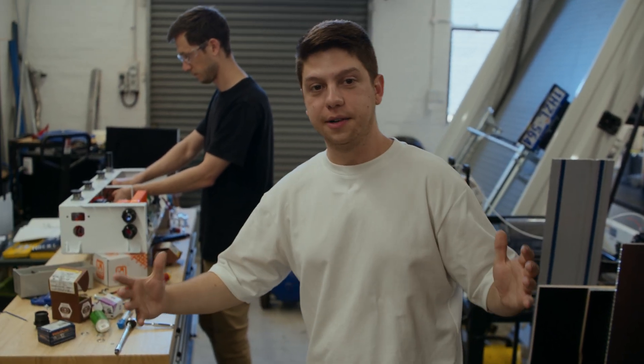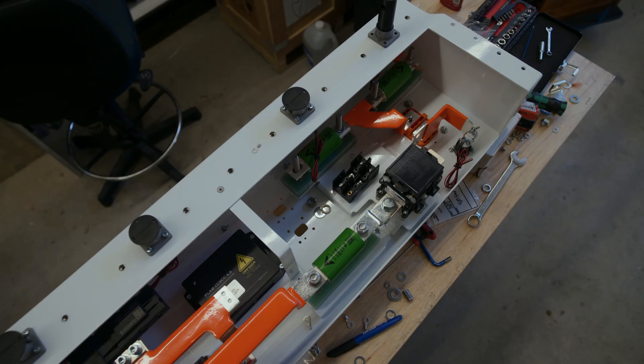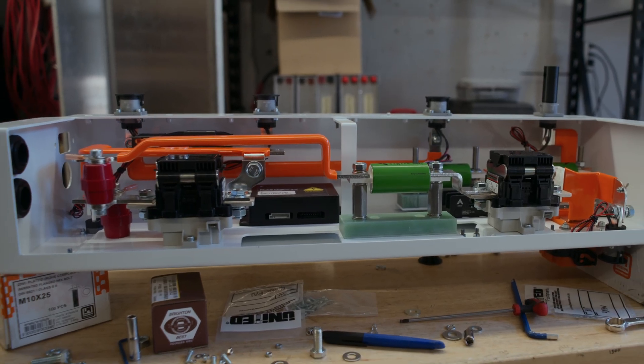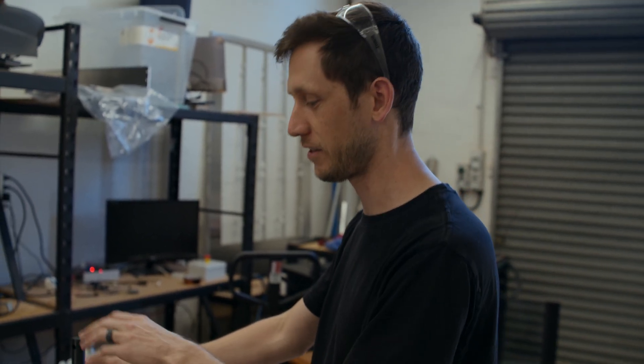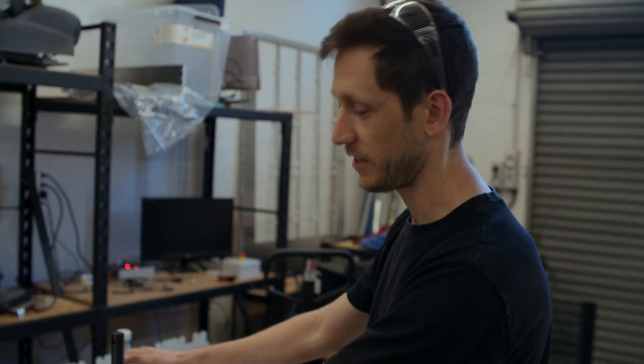At the front of our two batteries, we need to join them in some way. What we have is a combiner box — a pretty standard way to do it. The purpose of the combiner box is effectively to safely combine the two sub-packs together. We do have contactors in the sub-packs, but what this does is bus the two into a common output, so we can then run that both to our inverter as well as the DC-DC and any other high voltage equipment we have.